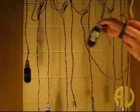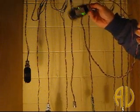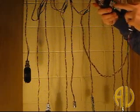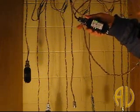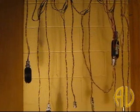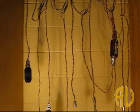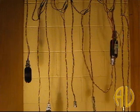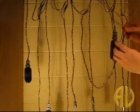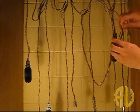Yes — we heard the beep and all the J1939 LEDs are lit up. We have found the J1939 network. Let's mark it. The cavity for the yellow wire is CAN high, and the cavity for the green wire is CAN low. Let's unplug it.